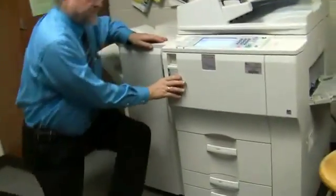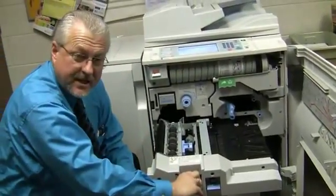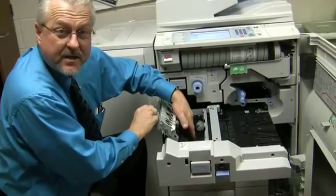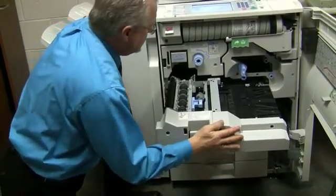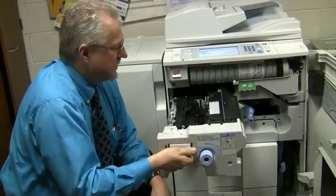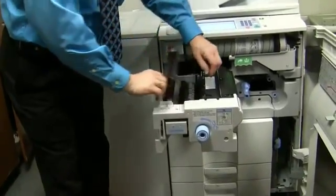Now, there are a few jam areas in the machine itself. If you open this door, they're all listed on the door too. For instance, if it says E2, you pull this down and this whole thing slides out. If it's under E3, you're going to lift it up — your paper's probably sitting here. If it's F, this kind of pushes and drops down, and your paper would probably fall right out as soon as you do that. Now if it says it's in D2, this lifts up and this pulls out. Now this unit is the fuser, so it is a little warm — be careful in this area. If it says D3 or D4, these things lift up like so.